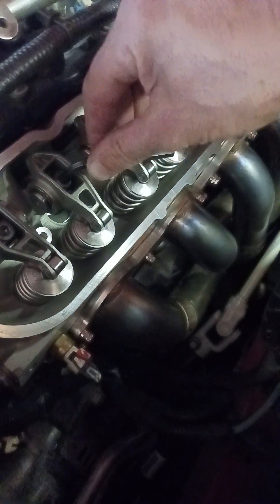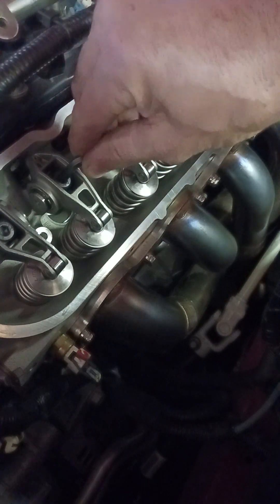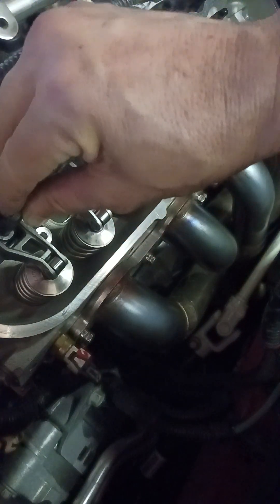Here's what I got going here — these are all just at zero lash. So we got half a turn on this one. Right about there — fully bottomed, so I don't even get one full turn on there. That's running at about 40 thousandths preload on that one.